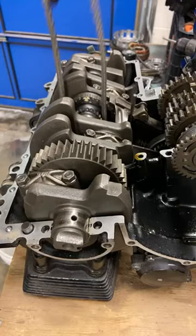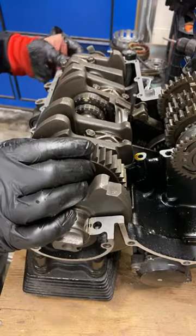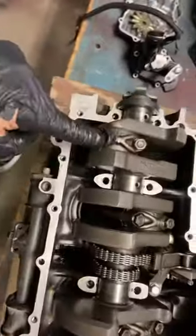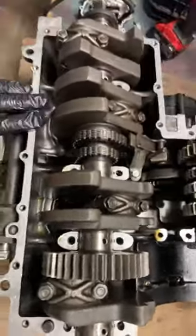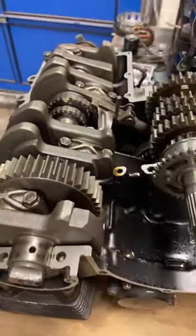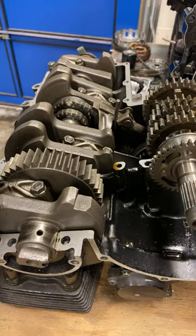We have here a timing chain, and another cute little similar looking chain there. And I need to undo these bolts here. This one, those two, and then those two, and those two. So this is a 4 piston, 1, 2, 3, and 4. These 4 pistons are connected upside down to this. So you're looking at the bottom of the connecting rod here. And that needs some wrenching. So I'm gonna do that with my 12 mil. Which one is it? 12 mil.